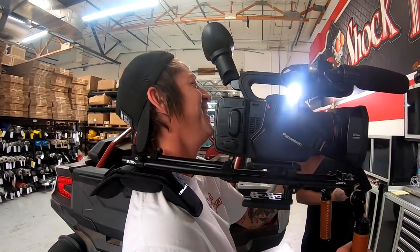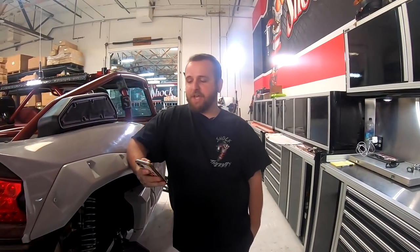R-Max springs aren't on the website yet because we're waiting for crossovers to be made. We already have the installation video done. Fox did a bigger body on that car - it is a 2.0 shock but actually a 2.05 or 2.056 diameter, so the normal crossover we have for 2.0 shocks does not fit on that specific shock. A new crossover has to be made, and once that's made everything will be up on the site.